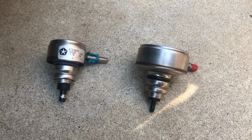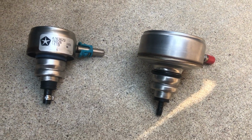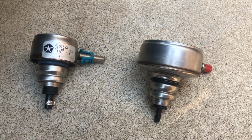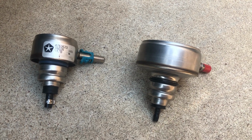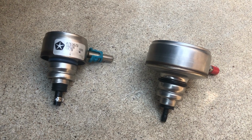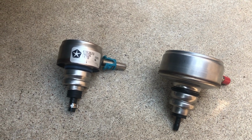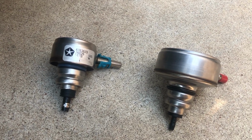And just so you could see the comparison between the 2 fuel regulators, one is significantly larger on the top than the other, but they're both 55 psi. It's just a different size at the top, so I'll need to figure out how to get that ring around it. I was debating to put the ring on first, but I think I can squeeze it, and squeeze the ring to screw down the fuel pump on. I can screw that down after the fact.